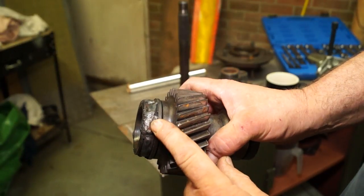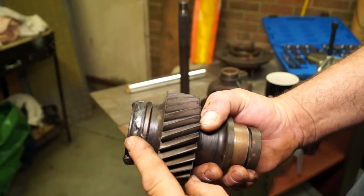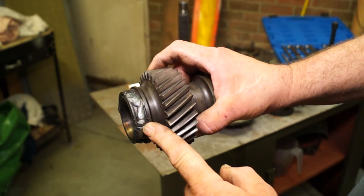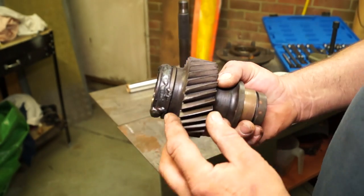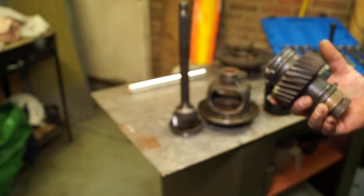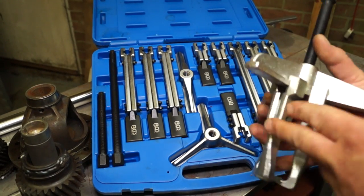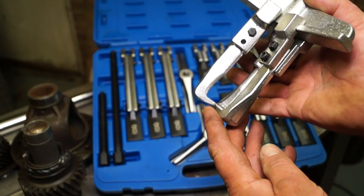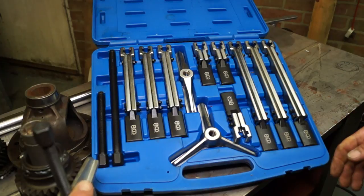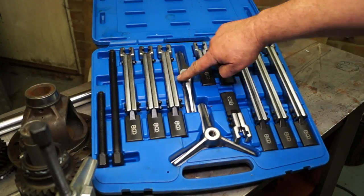What we have here is the input gear of the LT-230. I put a ring of weld around there and I was actually going to knock it off with a hammer because it was that loose. I left it to cool down, then put an extra couple of tabs on it and I'm going to pull it off — should be easy enough. This is my puller set, and I have an extra set here where these legs are a little bit too chunky. Also in this kit I have the three-legged and the two-legged puller with extensions.